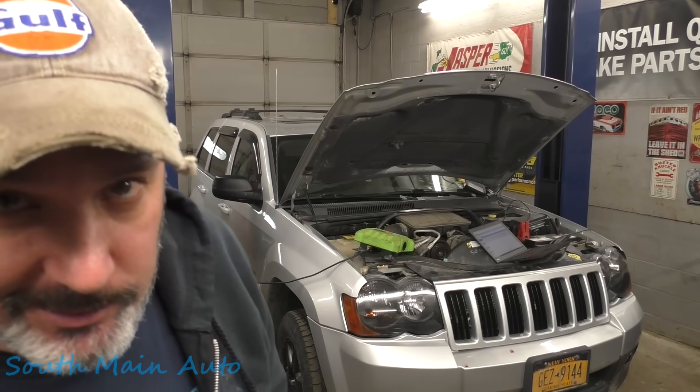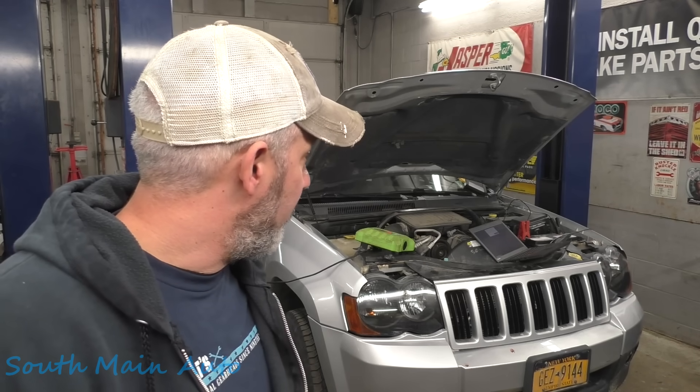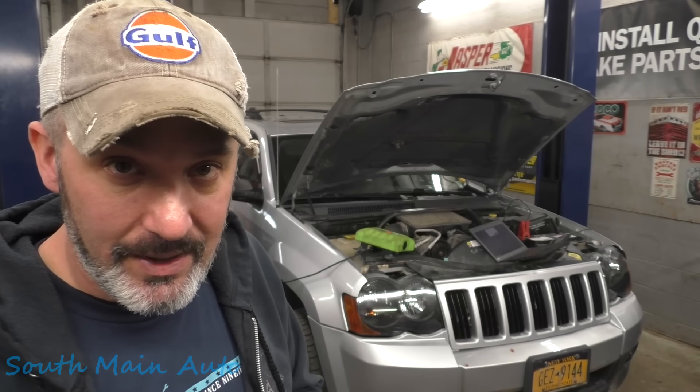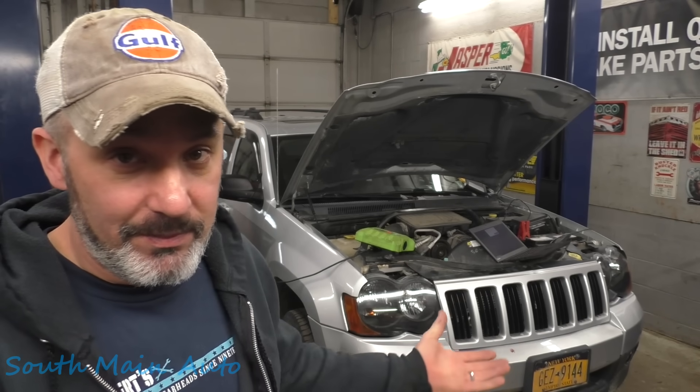It was hopeful there for a minute, folks. I'm at my end of my rope — I don't know what to do. I'm going to contact Keith over at L1 Auto Diagnostics to see if he has any kind of backdoor way to perhaps re-virginize this module and write the correct VIN to it, so it'll do the configuration restore properly. I tried the configuration restore again and it doesn't work. If he doesn't know, I may have to go online to professional forums like Diag.net and put the question out to the community, or even check Google. Somebody's been down this road — I'm certainly not the first.